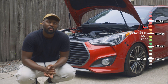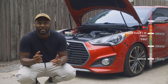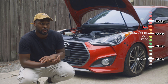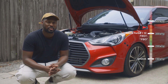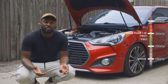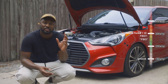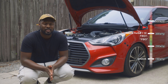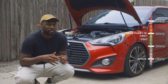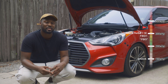When talking about fueling on this engine, pump gas is only going to get you so far in terms of timing advance and tuning, so you really want to start looking into fuels like E85, methanol injection, or higher-octane race fuel. The two fuel upgrades you're going to want on this platform — both old and new generation — are the low-pressure fuel pump and the fuel line. Your high-pressure fuel pump is capable of running that fuel, but make sure you treat each tank with some sort of alcohol treatment to protect the cylinders. You could run up to an E30 or E40 blend before getting a check engine light, but do those preventative steps first.